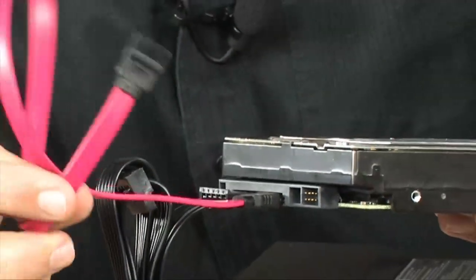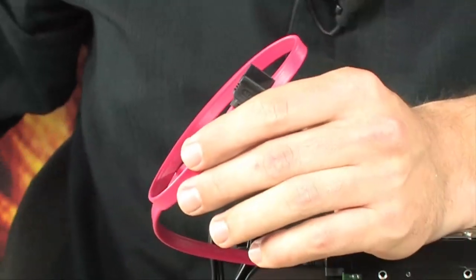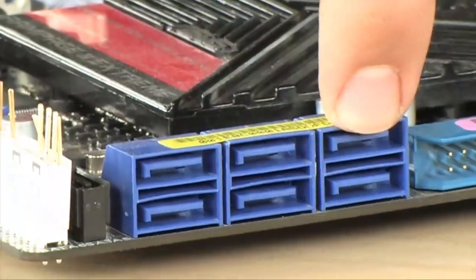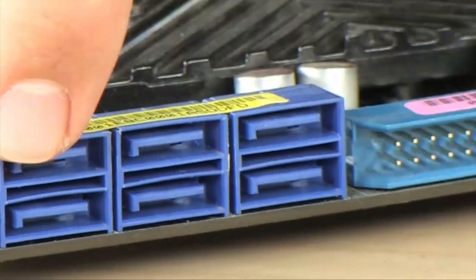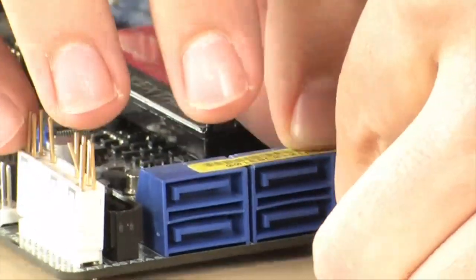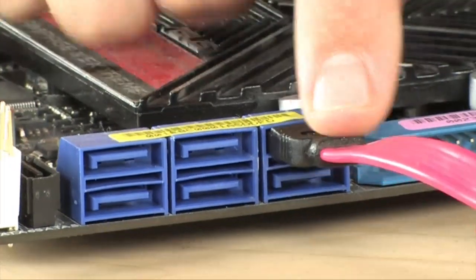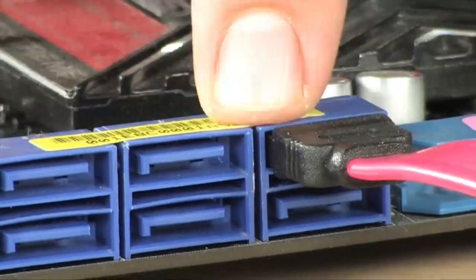It is important where the other end of the SATA cable goes — you can't just plug it into the hard drive alone. You're going to be plugging it into the SATA header on your motherboard. A lot of motherboards have as many as six, eight, or even more SATA headers, and it doesn't really matter which one you plug it into. Make sure you plug it in securely and firmly. SATA is kind of a hot-swappable, plug-and-play device, so once you plug it in, your computer automatically knows it's there.